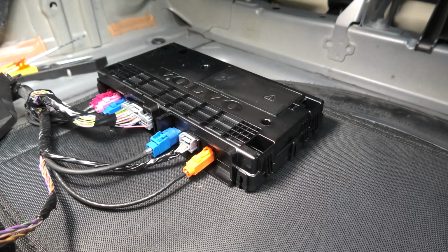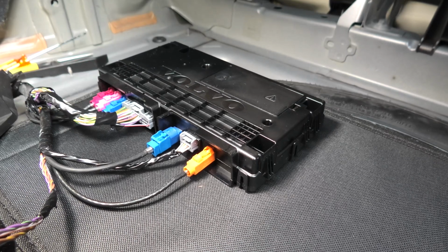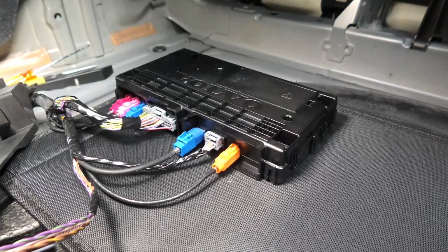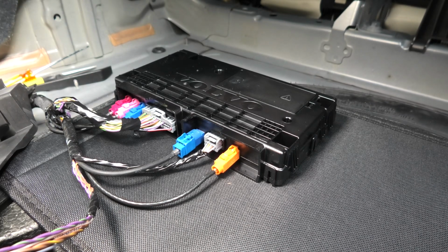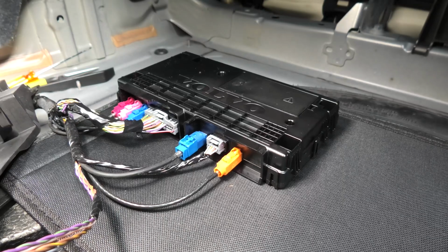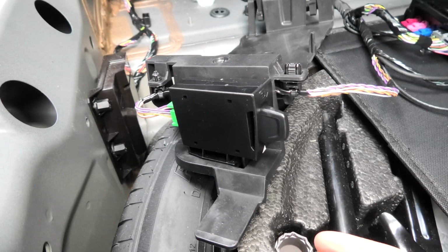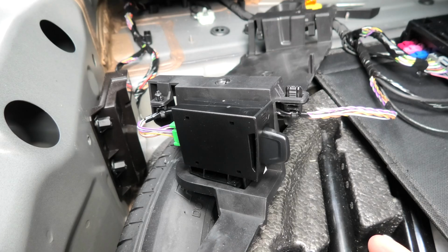Besides that, it works as a Wi-Fi client to connect the vehicle to the internet, for example using your smartphone or any other Wi-Fi hotspot. It can also serve as the Wi-Fi hotspot on its own to provide internet connection for your smartphone or laptop if you use the data SIM card. The SIM card slot is located next to the VCM module in our XC40. In the newer XC40 models, it will be located in the ceiling console.